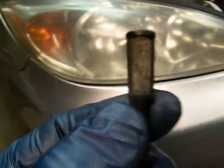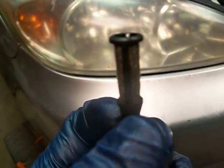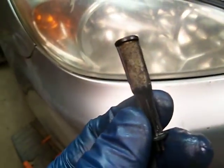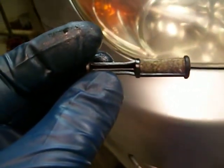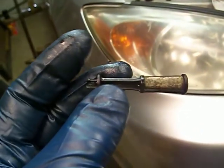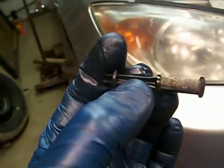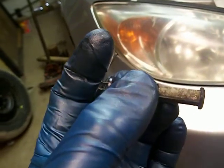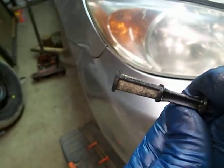Oh yeah, this screen, if you don't know what its purpose is, this has variable valve timing, and this is supposed to keep bigger pieces from getting in there. So you can find about anything on YouTube. It showed a guy actually replacing this. He left the Toyota part number for this, and that's how I was able to order it. Unfortunately, this was one of the parts I could not get on eBay. I actually had to get this one from the dealer, which wasn't too terribly bad. I think it was right around $13, maybe $18.